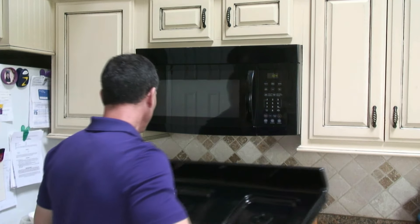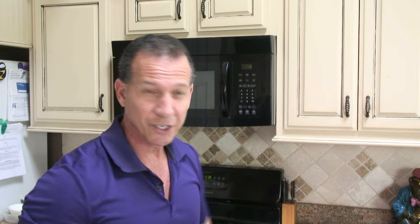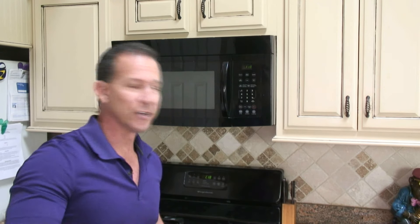Now that it's clean, you put it together the same way you took it off, except in reverse. There's one other thing I want to show you — how to clean your glass. On the inside of my oven, to clean the glass I use a straight razor, because it takes everything off without scratching the glass. You'll have to degrease it first if you have any grease on there. Just clean it off a little bit, dry it, and come back over and scrape it right off. Once you do that, you can come back again with a cleaner. Don't use abrasive cleaners on this — you really don't want to scratch that glass up.